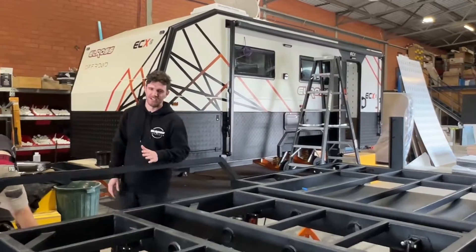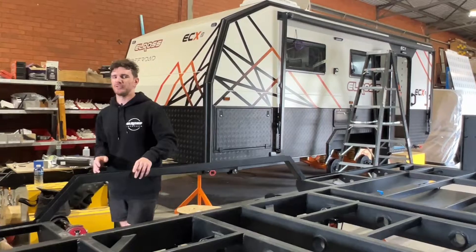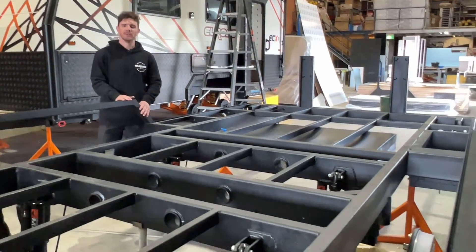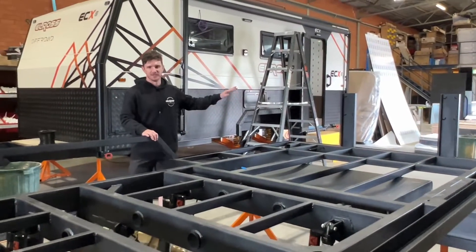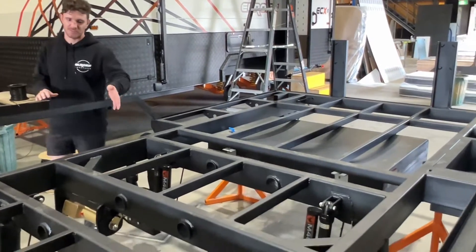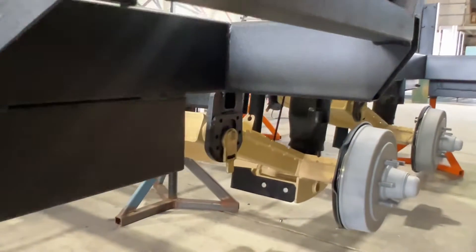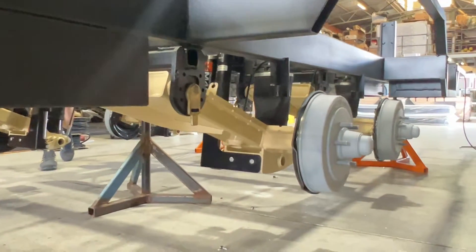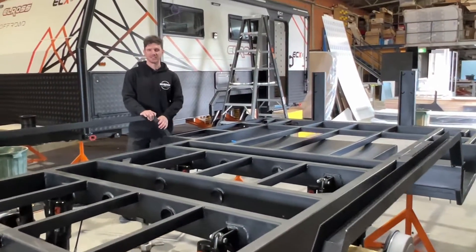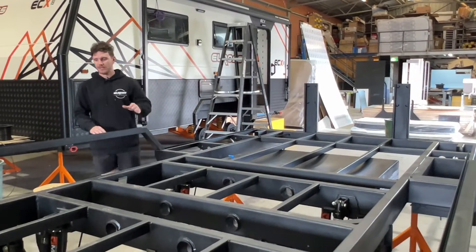Overall, with all these changes to the Gen 2 chassis, this 19-foot chassis here weighs approximately 20 kilos lighter than our older version, and that's partly due to reducing the weight in the cutaway back. With the ATX suspension we've actually added weight in some areas because we've got an extra 150x50x4 chassis rail that needs to be run for the ATX suspension, but on ECX chassis the weight savings will probably be a little bit higher than that.